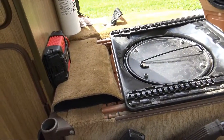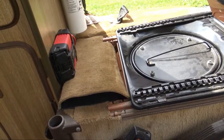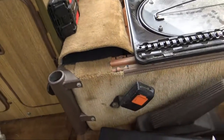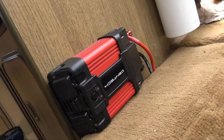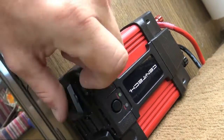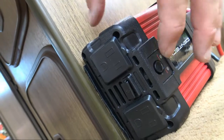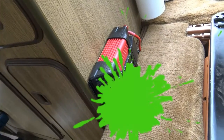The real reason I wanted the second battery: we just hooked up the power inverter, which is mindless — red to positive, black to negative. We routed everything to the battery and mounted it right behind the driver's seat. You shut the power inverter off when you're not using it, turn it on for constant power. We've got two outlets and a USB right in the middle. It's a 400/800-watt unit with a built-in fan, and we basically want to use it for charging our devices on the road.